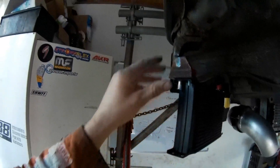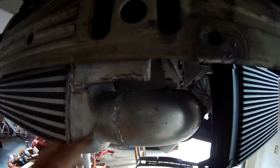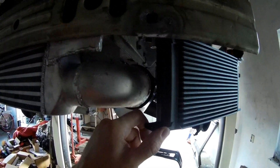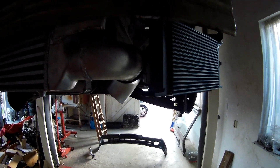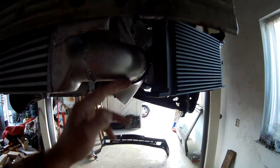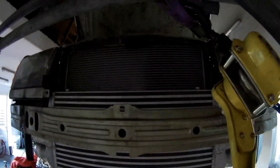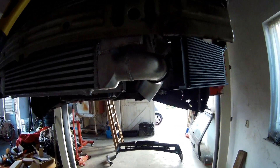Now the bumper will go over it. I'm going to make one modification to the cooler setup. I'll have to make one bracket from here that goes underneath the pipe — this will be supported by bigger bolts later on. There's a little bit of movement in it, and with oil in it that sort of thing needs support from another angle. So I'm going to make another support — three-point supported. I think that's the best way. So three coolers: oil cooler for the engine, intercooler radiator, and oil cooler for the transmission. Looks pretty good — I'm going to make those brackets, put the bumper on, and show the final result.